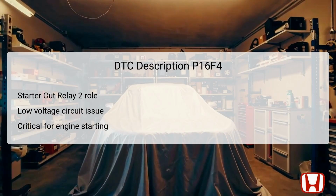DTC P16F4 refers specifically to the starter cut relay 2, indicating that there is an issue with the control circuit having low voltage. The starter cut relay 2 plays a pivotal role in enabling the engine to start by connecting power from the battery to the starter motor at the appropriate moment. Located within the engine compartment, it works in conjunction with the powertrain control module, PCM, to manage the vehicle's starting process. If the control circuit is underperforming or exhibiting low voltage, it can directly lead to starting issues. This could manifest as the engine being unresponsive when attempting to start. Understanding the role and location of this relay is essential for effective troubleshooting.